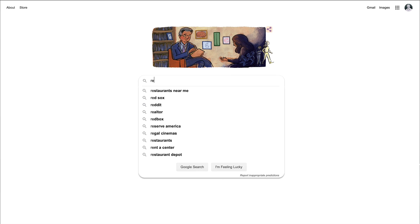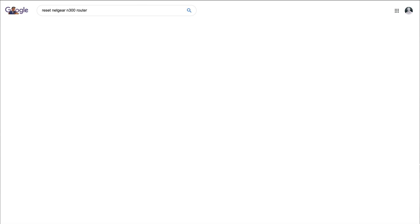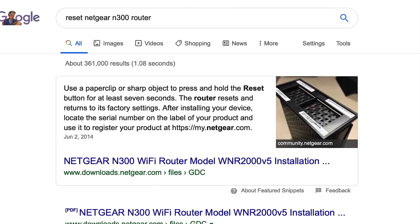There are ways to reset your router to factory default settings. If you want to learn more about how to do that — since there are a ton of different types of routers — sometimes there's a little pinhole on the back where you can stick a pin in for about 10 seconds and it'll restart. Your best bet is to Google the name of your wireless router manufacturer along with your Wi-Fi problem and there'll be steps for you. If your iPhone won't connect to any Wi-Fi networks, it's probably a problem with your iPhone.